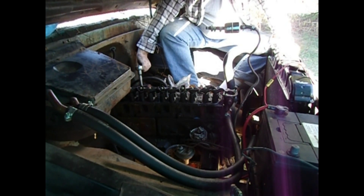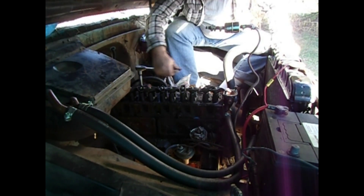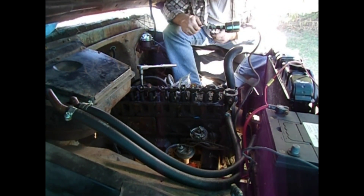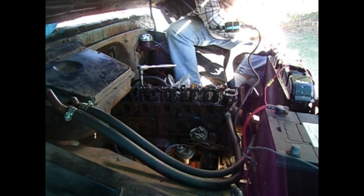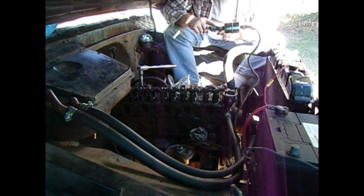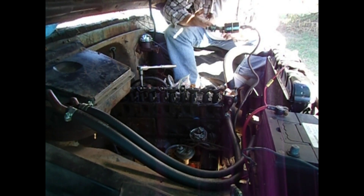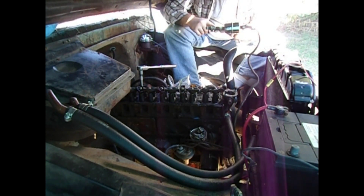What I do is put the bolts in and seat them firmly, but not cranked down too much. Then crank them up to about halfway — maybe 45 foot-pounds or so — and then work your way up, keep going around until they're all at 95. Then go around and verify, because as you crank one bolt down the other bolts will be under relatively less pressure. So you'll have to go back and crank them down again in the circular pattern. Otherwise you'll wind up with bolts on the outside at 95 and bolts in the middle much lower. Just keep going over and over until they're all tight at 95 foot-pounds.